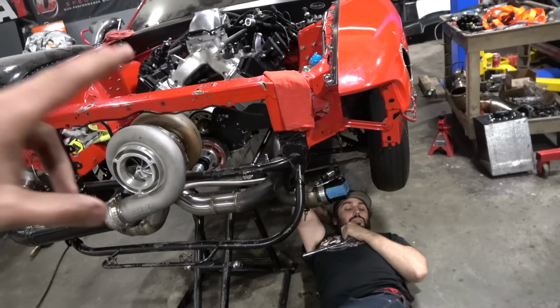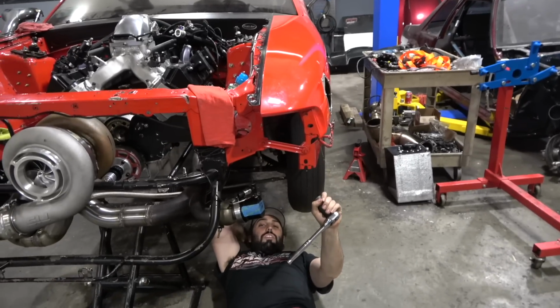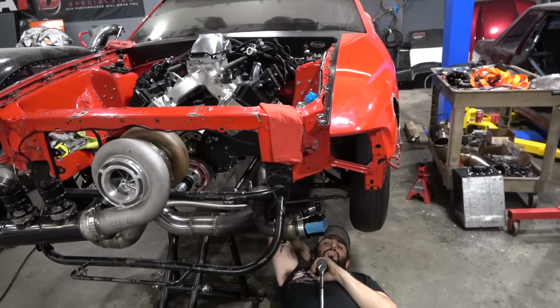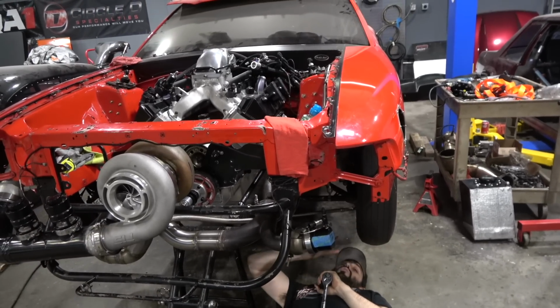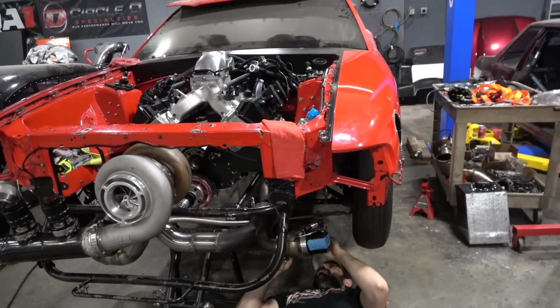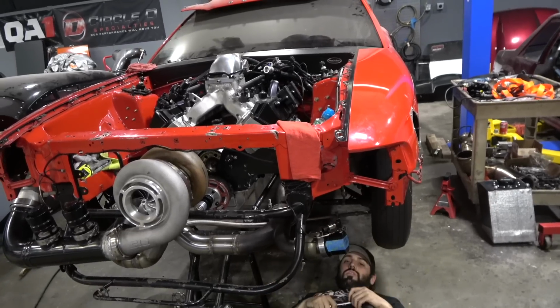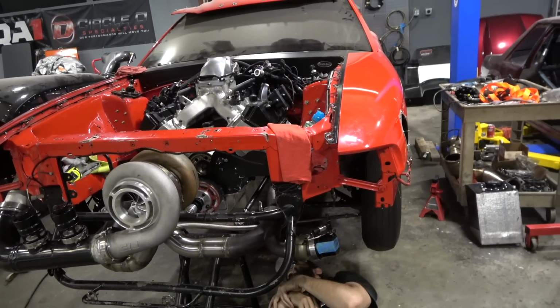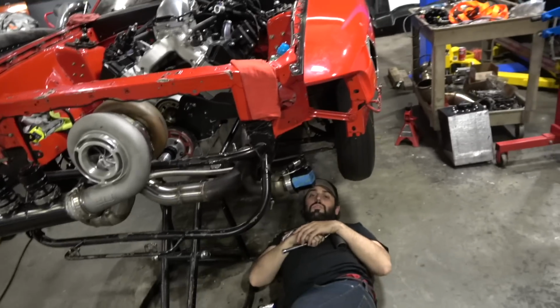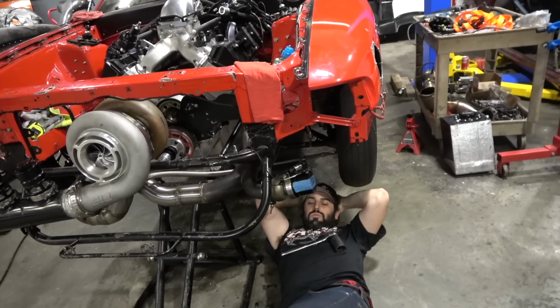Yeah. So now I'm going to cram it in there. It starts like one thread, maybe one thread. Now two. Two threads, and then it just stops. It's supposed to be ORB. Now, hold on. Was it even machined for the O-ring? I mean, it's just a flat surface. Yeah, see, it should be machined for the O-ring to seal in there. Like, it should have a receiver groove? Yeah, receiver. I understand what you're saying.